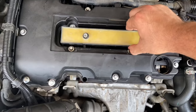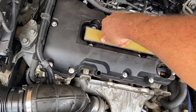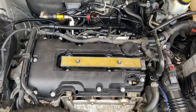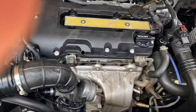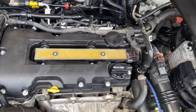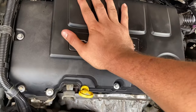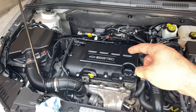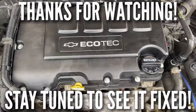Once all the bolts are tightened up, we pop in our coil pack and tighten it up with the T30. Let's tighten this up, plug it back in, plug your battery back in and you should be good to go. Let's put the gas cap back on and the dipstick back on, then this cap back on. Let's plug the battery in — and that is how you take care of that issue. Thank you so much for watching, and don't forget to like and subscribe.